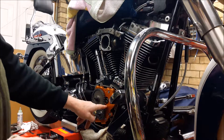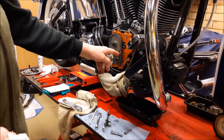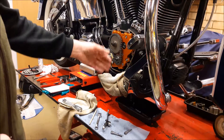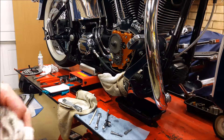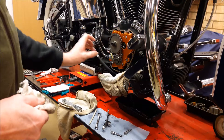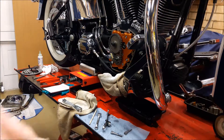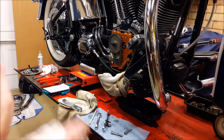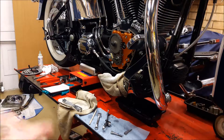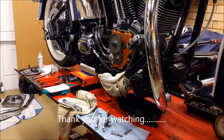The one thing that did surprise me: there is no seal on the oil pump. On the original pump there's an O-ring in the face where it bolts to the cast plate, but on this replacement — and it's the same with both tensioners — they just bolt straight to the face with no O-rings or gasket, and the literature makes no mention of any gasket. That did surprise me a little, but other than that it seems to have gone reasonably well. Proof of the pudding is when you start it up and run it — I'll bring you back as and when. Thank you for watching.